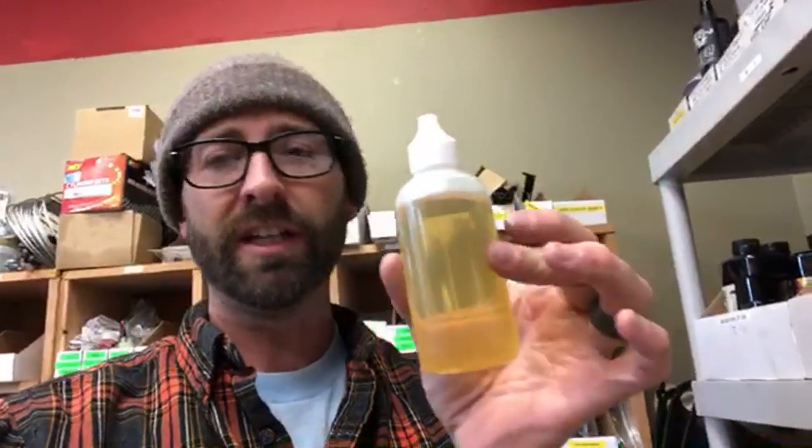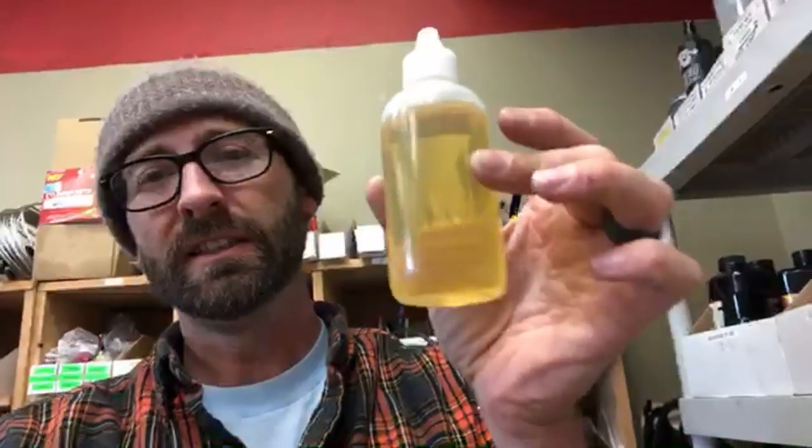This is the oil that we use. This iRide oil, it's pretty good. And this is actually something new that we have. We don't have this on our website yet, do we? No. These are pre-measured 125cc gear oil bottles, which makes it really easy to do the oil change. But to answer your question, don't run that oil more than 100 miles, and then upgrade. I wouldn't use a synthetic oil. I would just use a bulk oil on that, change it every 500 miles. Okay.